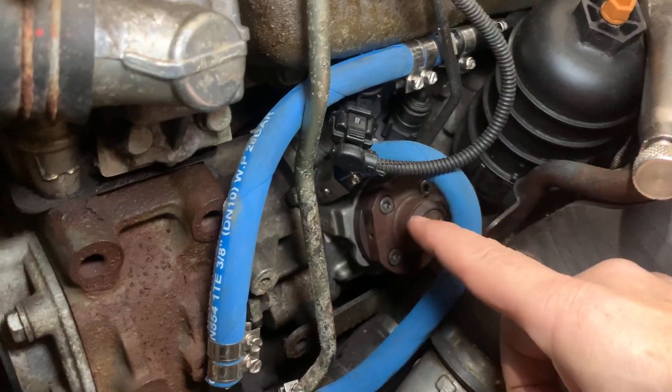The only thing I can think of that could possibly be causing this engine not to generate fuel pressure is if somehow we have an airlock inside the CP4 fuel pump. The way this fuel system is designed, that shouldn't happen — the electric pump down by the fuel tank is designed to push fuel all the way through the entire system if you ever run out of fuel. If you read the manual on how to start this engine after running out of fuel, there's no mention of cracking injectors or opening areas to bleed air out.